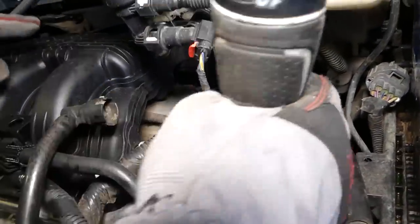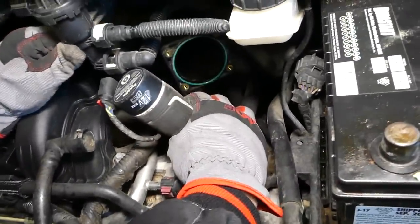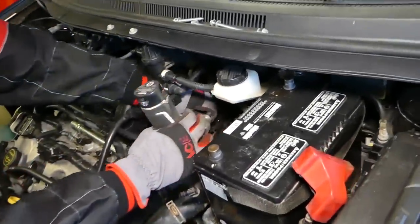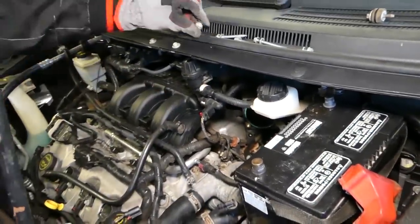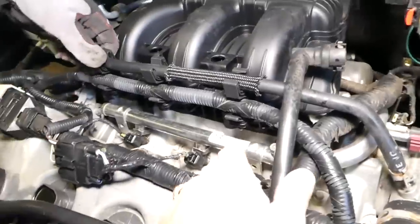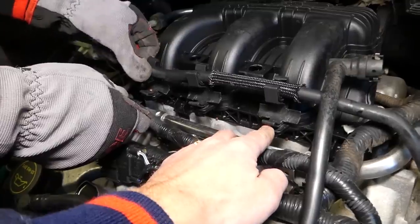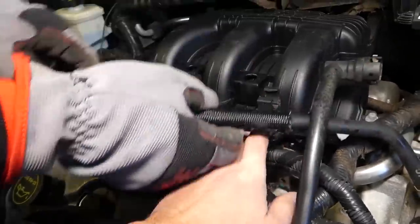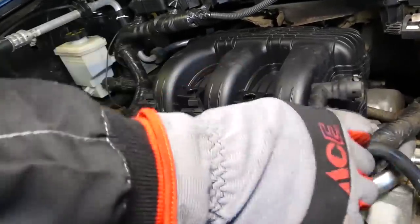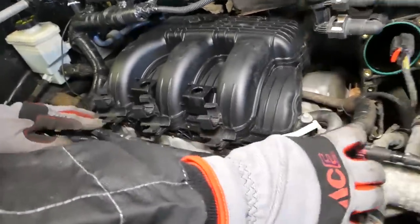there, this is an 8 millimeter, okay, this thing needs to go. Okay, perfect. This one is out. Now, we need to get a plastic clip removal tool, okay, and we need to pull. Okay, you have two options. You can pull the hoses out, or you can go ahead and pull those holders here and just pull them to the side. We'll just leave ours like that.